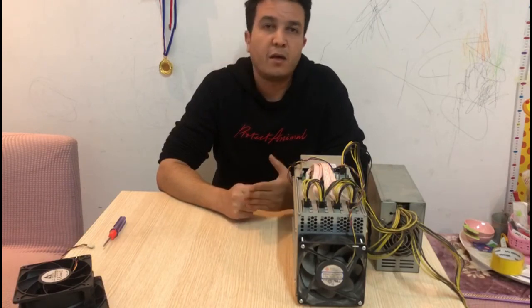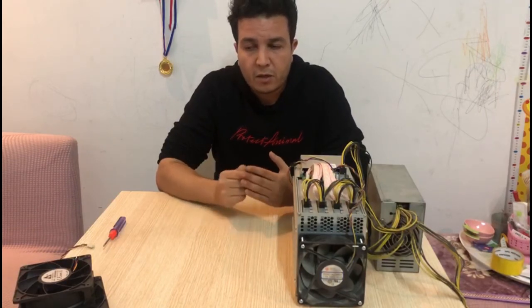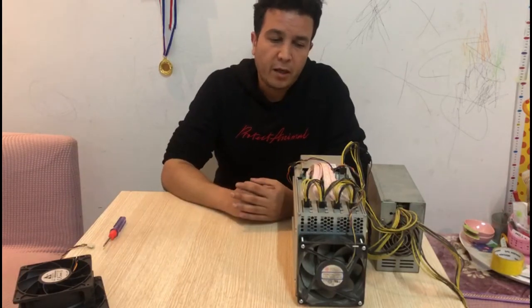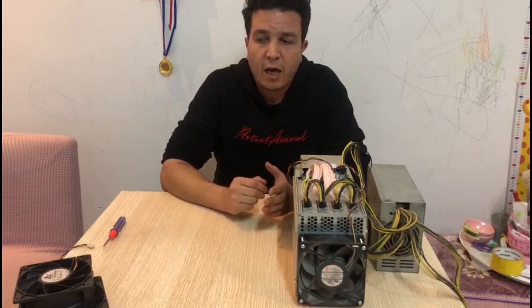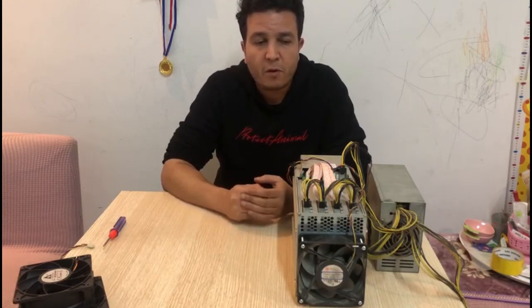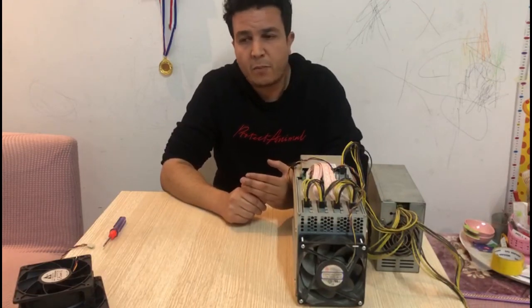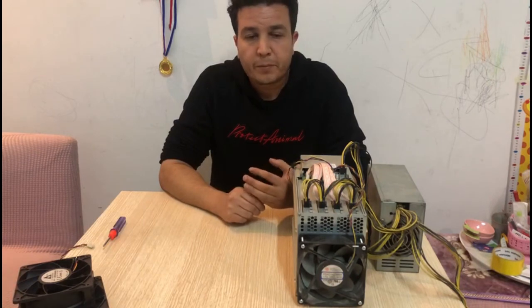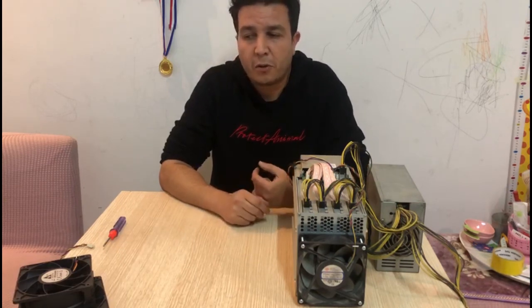All right, guys. So here we have the two options. I showed you how to reduce the noise of your ASIC miner through the software, and also how you can swap your fans for better, lower speed, more efficient ones. In this case, I think if you're using the L3 Plus or the L3 Double Plus from Bitmain, you don't have to change your fans. You can just do that through the software. So it's a cheap way to reduce the noise from your ASIC miner. But if you're using a different brand such as InnoSilicon, where you have the A4 Plus, A6, A6 Plus, where you don't have the option to adjust your fan speed, I think you're left with the option of changing your fans.